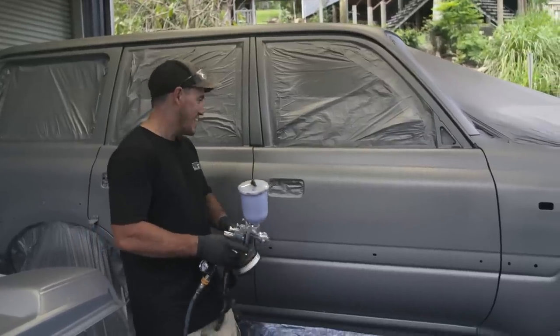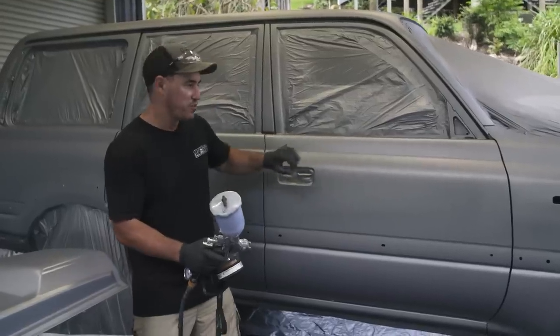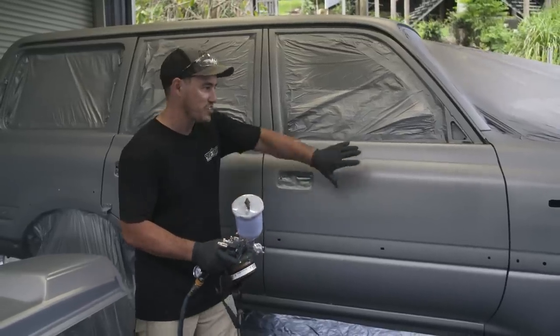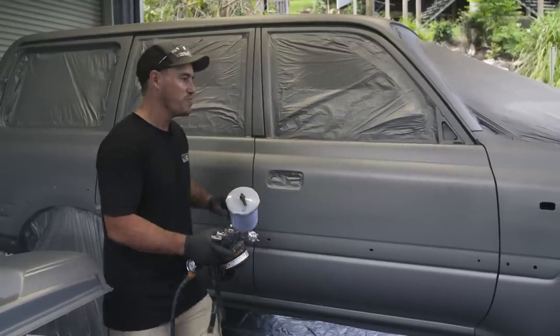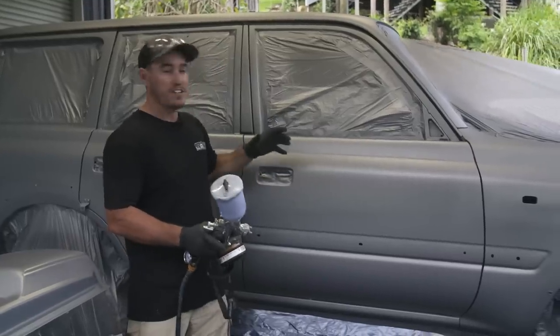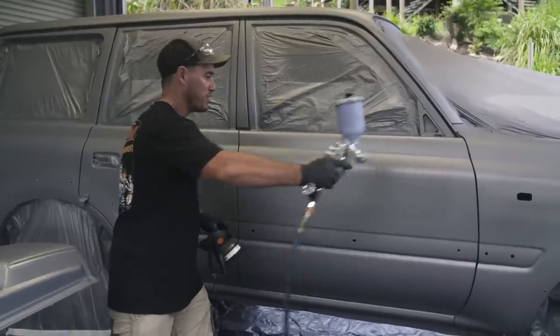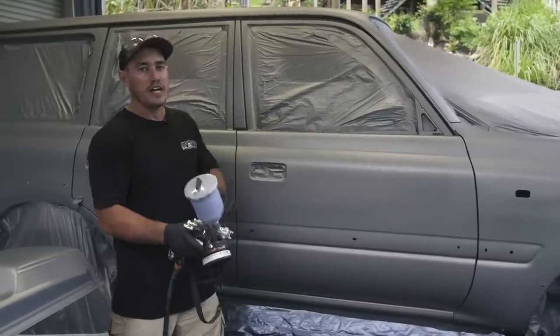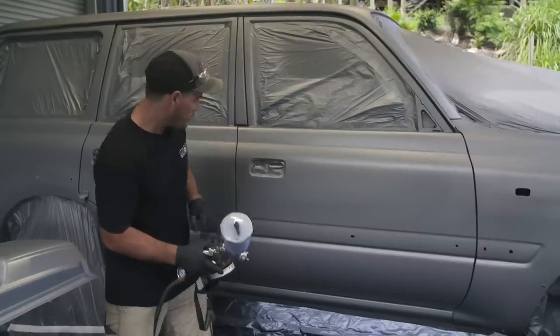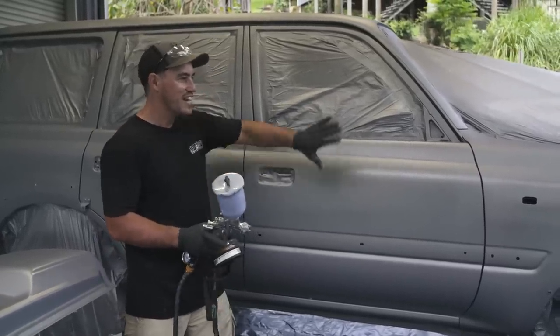One thing to watch: on this panel behind me you'll see darker and lighter patches of the Raptor mixed together. That's where I've held the gun a little bit too close and then a little bit too far away, giving you wet patches and thicker application in certain spots. The good news is you can touch that up - when you wait for your second coat, hold the gun a bit further back and give it a light spray to put a nice uniform coat on there. Even so, for someone who's an amateur at using a spray gun, this is coming up pretty good.